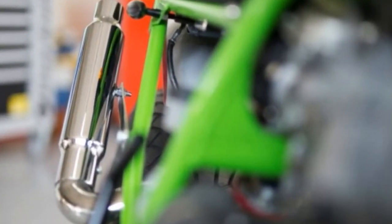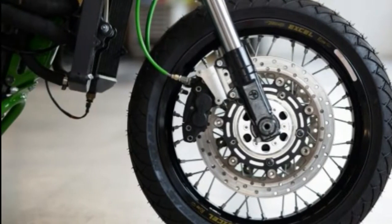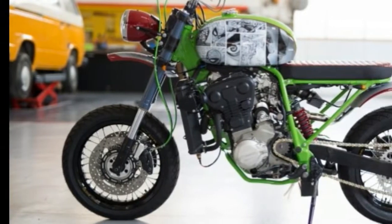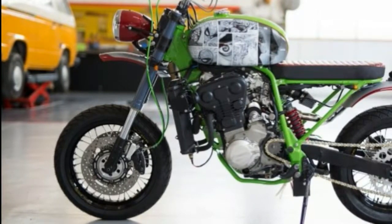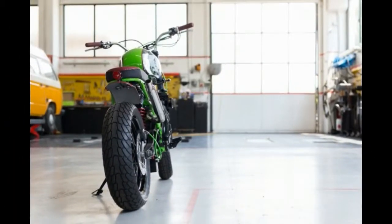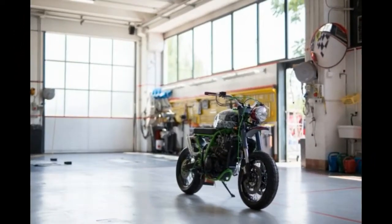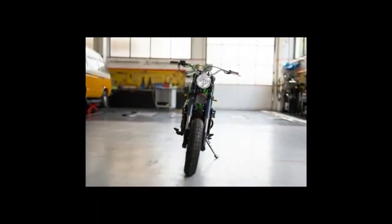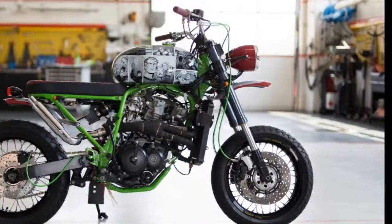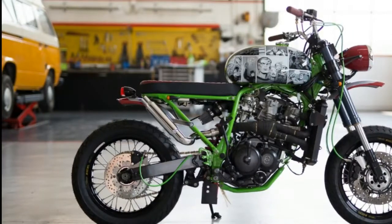The-Marvel-Ous started life as a Gilera Nordwest 350, a 90s era adventure bike with a dohc, liquid cooled, 4-stroke, single cylinder engine capable of approximately 33 horsepower. For the early 1990s, the Nordwest 350 was a relatively advanced motorcycle. It was fitted with 41mm upside-down forks, twin front discs, a power drive monoshock, and the engine was utilized as a stressed member to help keep weight down to 140 kg, dry.